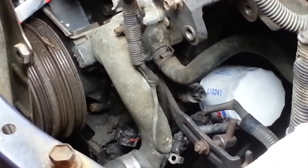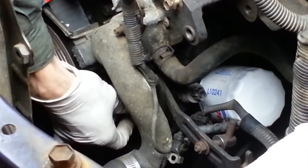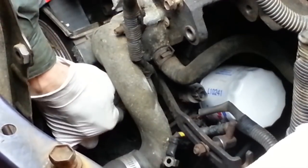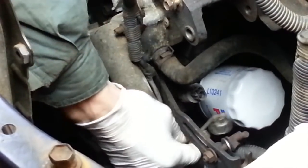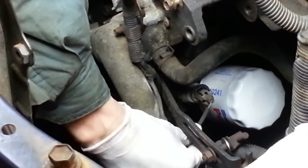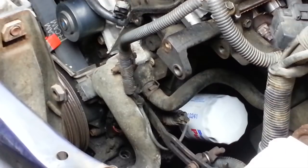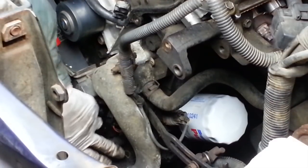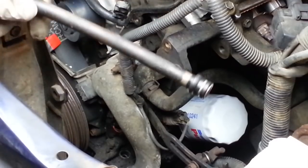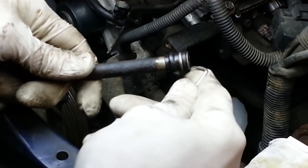There's these 2 sensors to reconnect down here. One with the red wire, and the other right here is next to the oil filter. Let's reinstall the dipstick tube now. You can see the hole right down here, just above the oil pan where it goes. And it was pretty grungy. I cleaned up the end of it, but we do need to replace this O-ring.